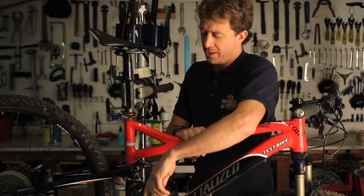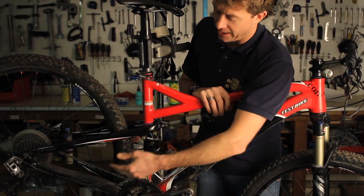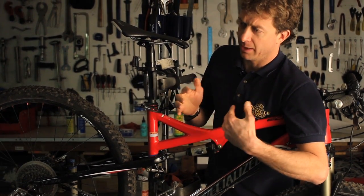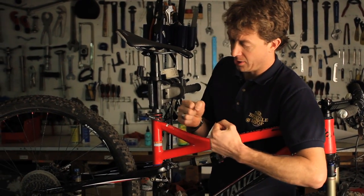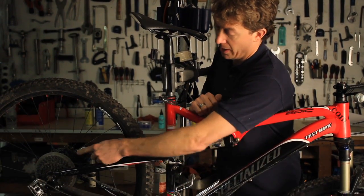If you notice on a drivetrain on a bicycle, everything is pretty much exposed. So dirt gets on the chain, and the dirt acts as a grinding agent. The chain will actually, they call it chain stretch. It's not actually stretching, it's basically a wearing of each pin, causing the chain to grow. As it wears, the chain rings also wear.